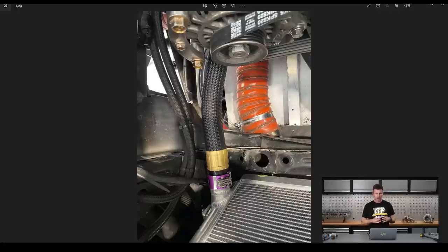Another change is the cooling system in terms of the radiator and the lines. We inherited this car with a 400 horsepower Toyota V8 and a radiator that was a little bit marginal for the application. We got it to work with the V8 by doing some pretty elaborate ducting, and that worked initially with our SR20, but as soon as we wanted to start turning the boost up for sprint races — running up around 600 horsepower — within one lap on a warm day the engine coolant temperature was up above 100 degrees C. Even at endurance trim, 16 psi at around 450 flywheel horsepower, it was marginal at controlling that temperature, and we'd have to start short shifting or dropping boost to control it.